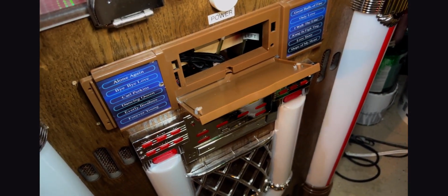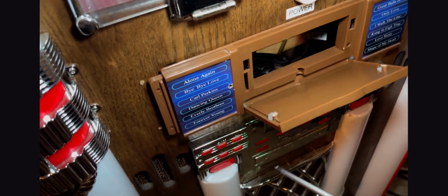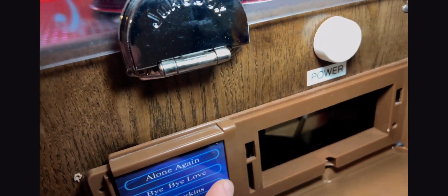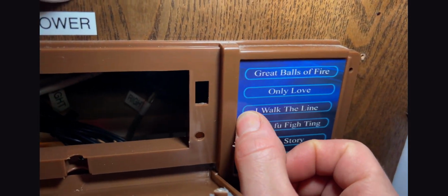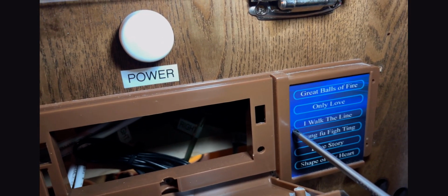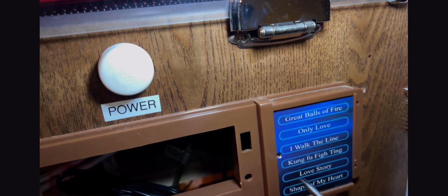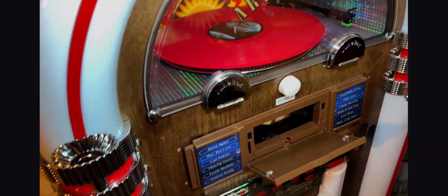All right, so once you get those 2 screws from the back, what you're going to have to do is kind of feel right in this area right here. There is actually a screw behind this sticker. So it's going to be right about there, and you can see the indent. So what you'll do is you'll just take your screwdriver and pop a hole in the sticker, and then you'll turn and release those 2 screws, which will essentially pull the whole faceplate out.